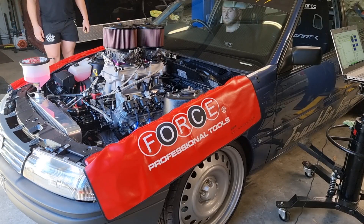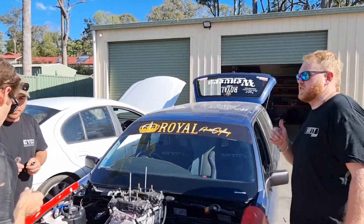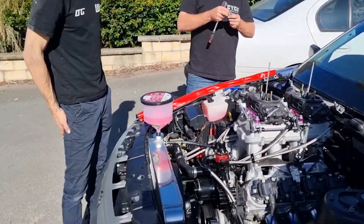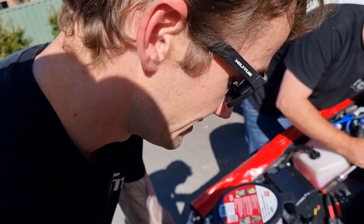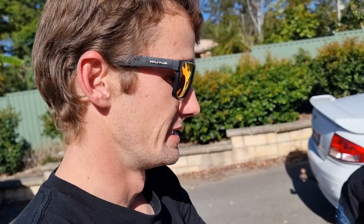Do what you normally do now. Damo, fill us in — what's happening? Just trying to get it to fire up: fueling tweaks, setting the timing, checking the fuel. Found a couple of little issues with the carby. Double-checking the plugs now — putting a bit more gap on them. They were at 0.024 and we might have overlooked gapping them. We're now setting them to 0.043. We've adjusted the idle on the carby as well — the air mixture screws were done but the throttle openings had been left as-is and we found they were all a little bit out.